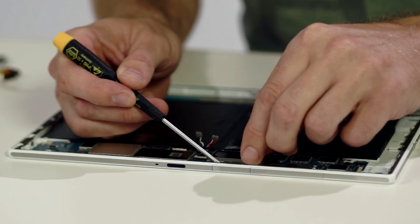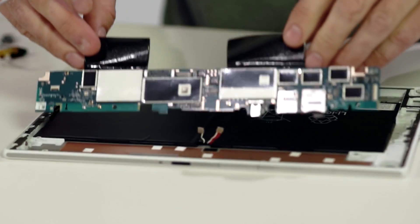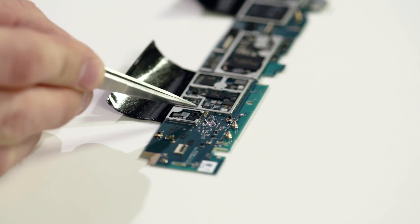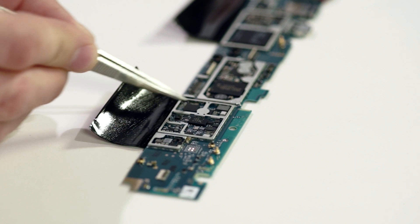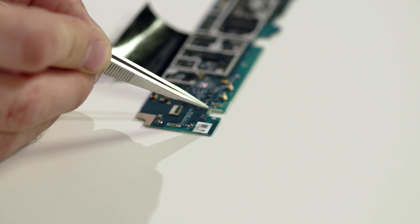Let's also unhinge the USB port. Almost to the motherboard now. One last screw is keeping the board seated and we're ready to pull it up. You can see it has shield cans. After removing the shield cans, we can take a closer look. We have the right speaker amplifier and next to that a connector. We also have a section called no mount — this is used for the Japanese version with digital TV components. Next is the LED light and the cellular network component.